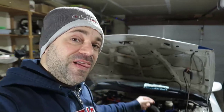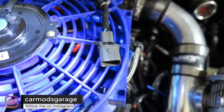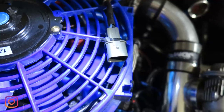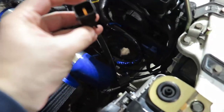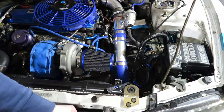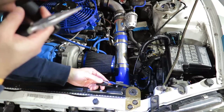I am sure that this connector arrangement is not correct - not because Mishimoto did it wrong, but because I bought the fan shroud for the 2G Eclipse turbo. This is the one I just took out, and you see the top - the right side is negative, which is ground - and the left side is positive. On the new connector, there's a click on the top. This side should be negative, this side should be positive. I'm not a connector specialist, but it worked.